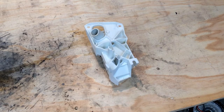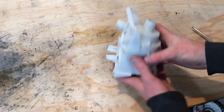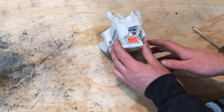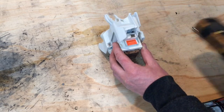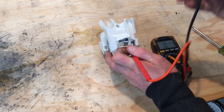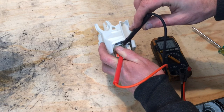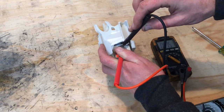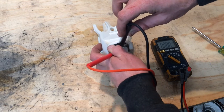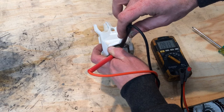So now we've got the pump on our bench, we're going to take it apart if we haven't been able to see anything or if there's something we can't get to. Something else to check is the resistance of this pump — it should be 90 ohms — so we just check it out. And this one is about 91 ohms, so that's pretty much our target. Usually if they're faulty it'll be open circuit.